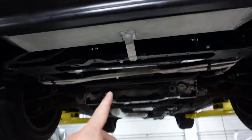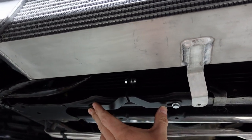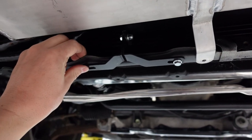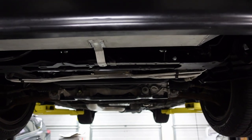Now another thing you guys will notice - my car is slightly different from the rest of you. I've got this bracket here and here, one for the intercooler and this one is for my automatic cooler. You guys most likely won't have this and I don't think it's going to cause me a problem because it should be a pass-through. So that plate will actually hold this up still. Joe really, really took his time with this. Also his name's Joe - I don't know why I keep calling him Joel. So let me go ahead and put this up here - I'll just have one 10 millimeter front so it's not flapping down and bending the metal.